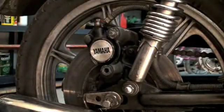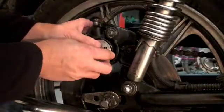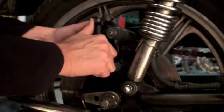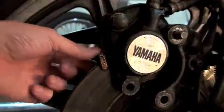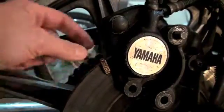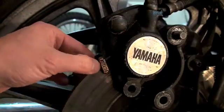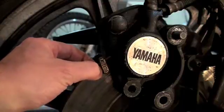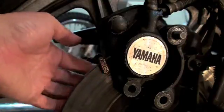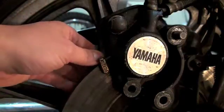So now we're going to negotiate this caliper off. Sometimes these can be a little bit tangly to get off, but this one's not too bad. These are the two brake pads themselves — there's actually two here, one for the back and one for the front. They have a little indicator on them, which shows how much brake wear you have. As these indicators get closer and closer to the disc, you know you need to replace your brake pads. These are actually pretty close — almost ready to be replaced. In fact, I will replace them while I'm doing this bike.